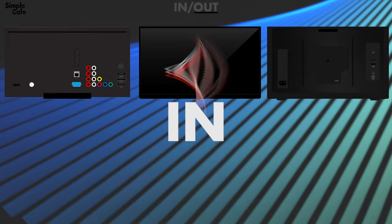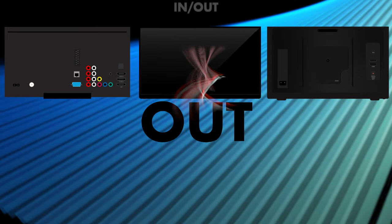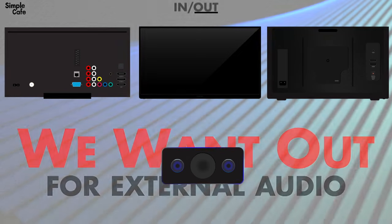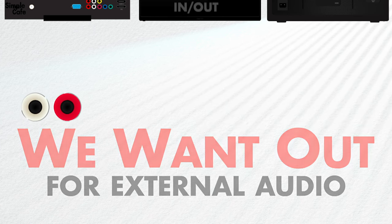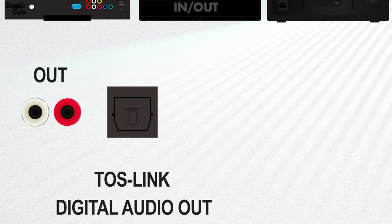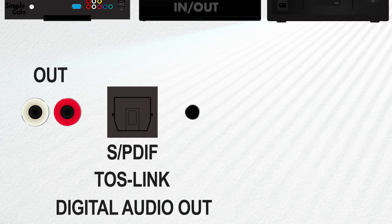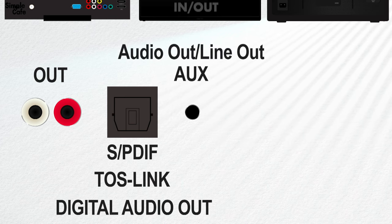So "in" is for the signals of your external devices to be sent in to your TV. That leaves us with "out" - out is for the signals within your TV to be sent out to external devices like a speaker. The port itself doesn't matter; what matters is the direction of that port's signal. If you're looking to connect through RCA, make sure it says "out." Here's an optical port, which may be labeled digital audio out, TosLink, or S/PDIF. And we all know and love the aux port, also called a jack or 3.5mm.